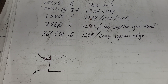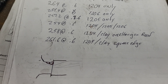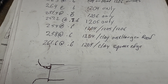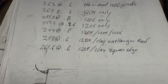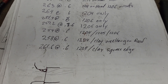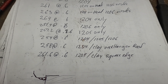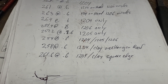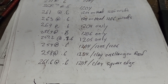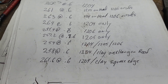It's not a long one — it's a little wacky experiment, but my little brain is working and I might as well show you guys what madness I'm thinking of. We're operating with a relatively small opening and pinch right now and getting 271 out of it. In reality, that opening is a little bit shy for our 1204 — I don't do my final gasket match until basically the heads are done; that's one of the last things I do because it's too easy to bang up and ruin. So give me some feedback on this, guys. Thanks for hanging out.